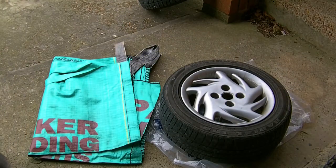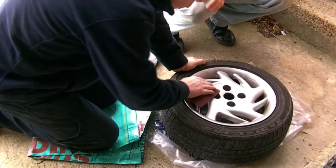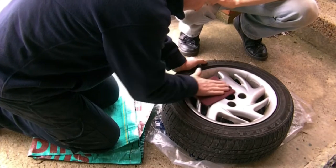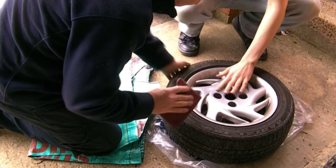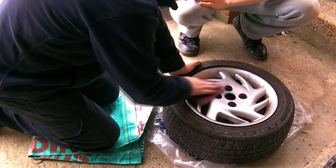A process that begins with a little lesson on paint prep from my dad. Basically, it's not a big shine off - just go over it lightly, try not to go through the paint if you can help it. Just smooth. Are you pressing heavily with that? No, not flat down, just... and that really is what you want. You can feel it as well - it's glassy. That's a rough texture, that's like glassy smooth. Just knock the shine off a bit all over.